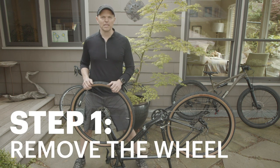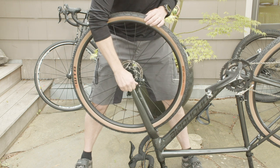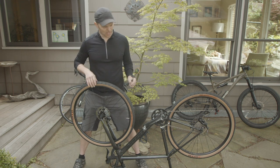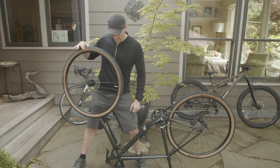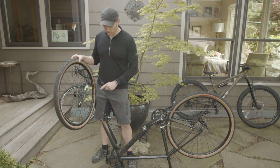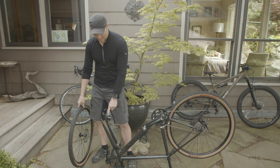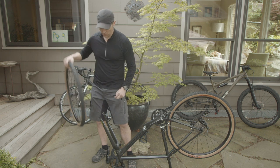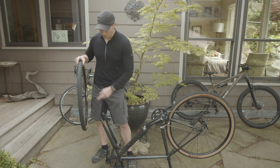I need to remove this wheel from the bike, and this one has a through axle — you can see it right here. I'm just going to spin that and pull the axle out, and once the axle is out it can just be lifted out of place. This is a good time to mention this has disc brakes, and I definitely do not want to touch either of these disc brake handles. You do not want to collapse those pads together inside there because you won't be able to get them apart and get your wheel back in. Anytime you remove a wheel from a bike with disc brakes, make sure not to touch the levers while your wheel is out.